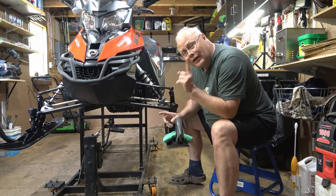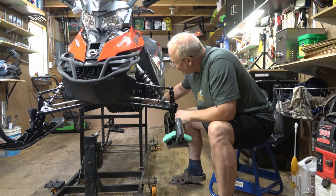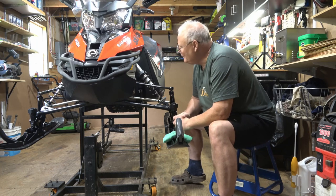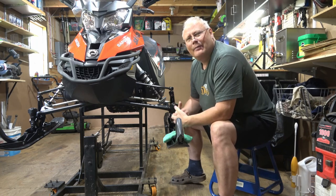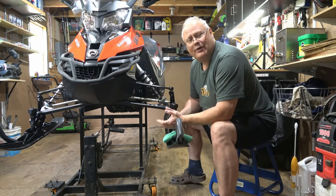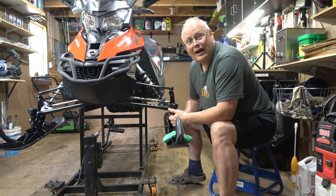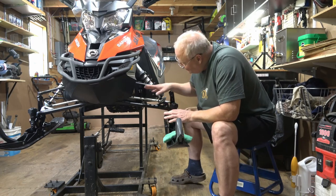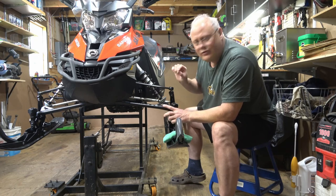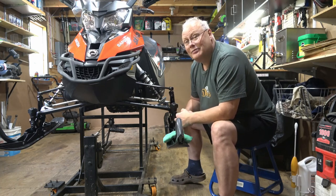Now, you are going to want to look at one other place, especially if the sled is new to you, before you buy it. And that's down in around the bulkhead, just to make sure nothing's bent under there or looks out of place. I don't expect everybody to be a master mechanic, but you should be observant. And that's what really separates an amateur mechanic from somebody that just doesn't know anything and just wants to ride. You can take a look underneath, and if you see parts that don't quite line up right, or maybe the bolt holes are missing a bolt here or there, you should be suspect before you actually buy the machine.